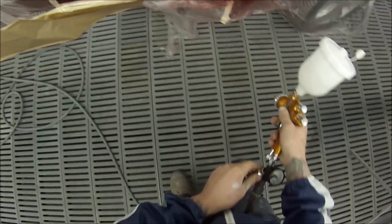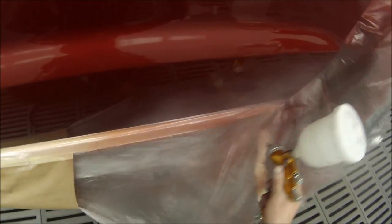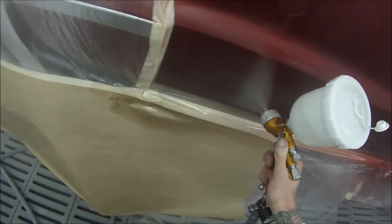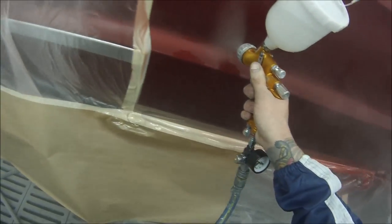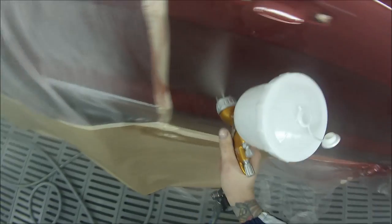The pressure in this spray booth jumps up and goes down — it's an old-school compressor. It's a great compressor, it does its job, but when there's so many people outside working it'll go up and then come back down. So if you've ever seen me adjusting my pressure, that's the reason why. If you're doing some home jobs as well, the same thing's most likely going to happen — if you've just got a small compressor and you want to paint a whole side of a car, you'll probably find you get two panels done and then you'll have to wait for a minute for the compressor to build back up. With this booth it's not that bad — you can still constantly paint, but you get slight fluctuations.